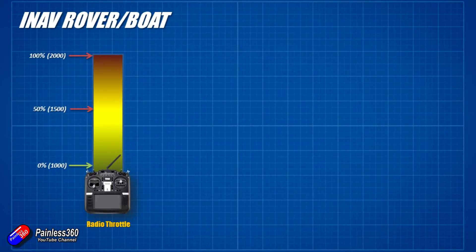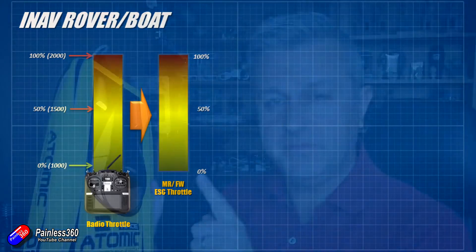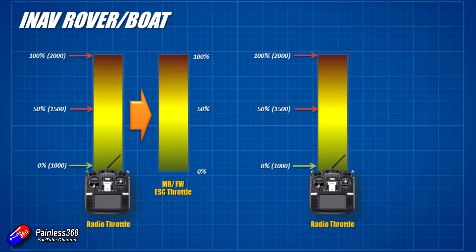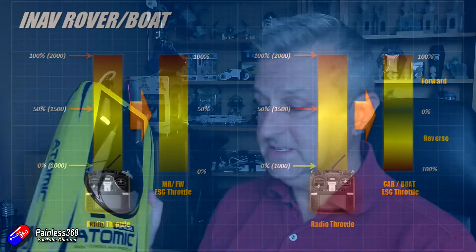One of the big differences is the way the ESC works. In a traditional plane ESC, you go from zero to 100% throttle in a linear line, corresponding to low to high throttle. On something like this, there is either reversing or — this one doesn't have a reversing ESC — but it works in a similar way. The middle channel position going to the top is forward, and from middle to the lowest position is reverse. So on a plane zero percent throttle is zero, but on something like this with a reversing ESC, zero percent throttle on the radio is actually 100% reverse, and fifty percent throttle means no movement.